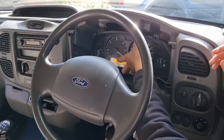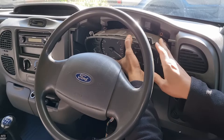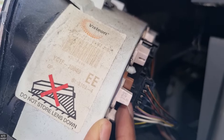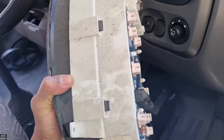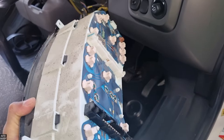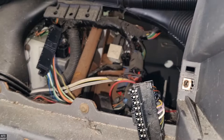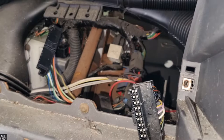Once you have the screws removed there are connectors at the back. Once you have the speedometer out you just have to take off this connector and then it gives you access to the other connectors. This was the connector and it's just a push-tab to release — looking from the back, you just push it and pull to release. Similarly with this one over here, just push it and pull to release. And if we look at the connectors here, that's what they look like.